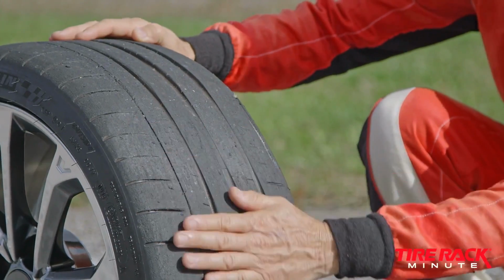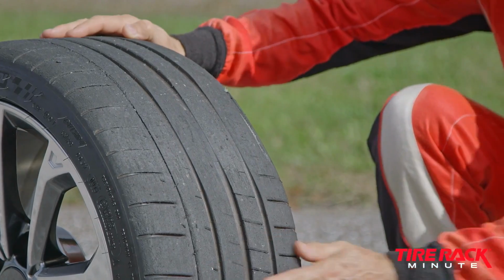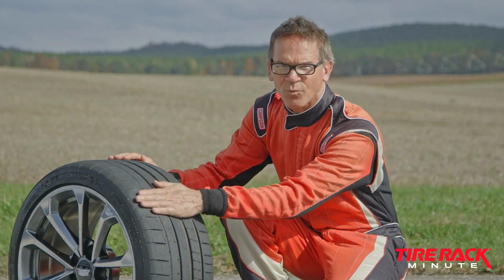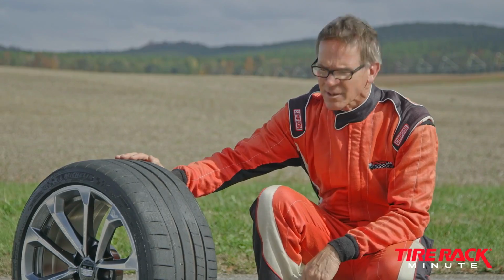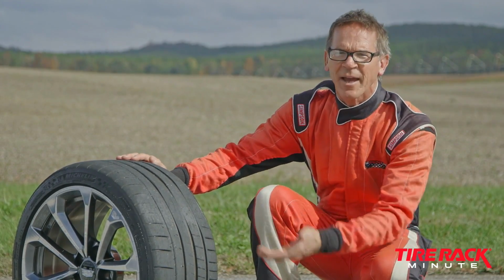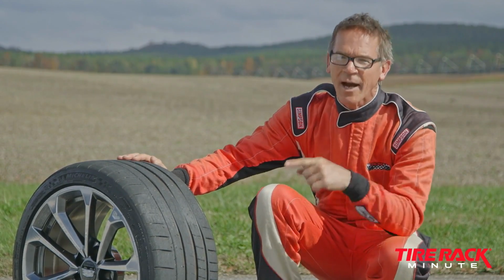Throughout a race, this is only going to get worse, too. The tire will tend to lock up right there in that same place. Flat spots will hurt your lap times, they'll ruin a tire, and if you haven't figured this out, tires win races. So what have we learned so far? The first rule of Brake Club is to not lock up your tires.